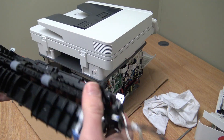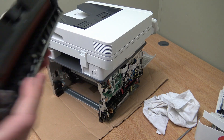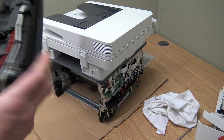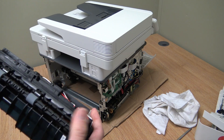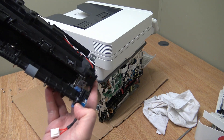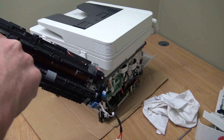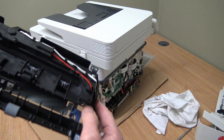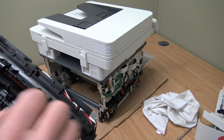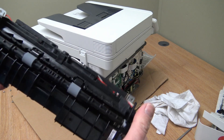When you get a new one, you put it back in exactly the same way you took it out, just in reverse. Be careful when you pull one of these out because they run at roughly 180 degrees C — very hot. These two levers here separate the two rollers. One end is a bit wrinkled at the bottom but that's normal — some brands do that. You can actually see the picker fingers inside as well; they're held on with a spring. On this model they're supposed to last 100,000 pages.